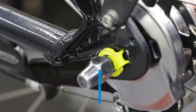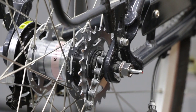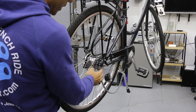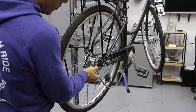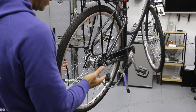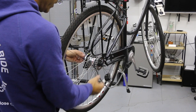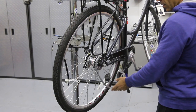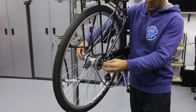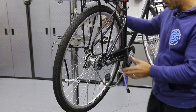They're actually slotted too, so we do have flat sides — that's actually fitting on perfectly there. It can go on two ways, either the top or the bottom. So we've got to turn it probably a quarter turn just like that — turn that with my hands. Now those little prongs are sitting inside, and then we're ready for our attaching bolt. So here we want to get the chain on — chain fell off on the front chain ring, so I'm going to start with the rear, place that chain on. Right now the wheel's staying in place all by itself, but it doesn't mean it doesn't want to fall because I haven't tightened up my bolts on the left or right side. So now we've got lots of slack here on the chain. I'm going to go ahead and snug up these bolts a little bit so it's almost touching, but still able to move the wheel forwards and backwards if I need to.